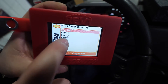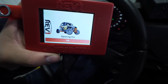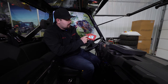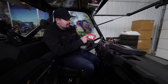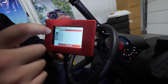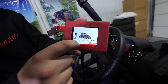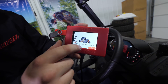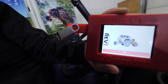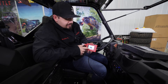We're going to click copy the tuner, go to an empty slot, copy to the slot, and let it load up. It's copied to the ECU — hit the back arrow again. Then we're going to go up here to the top left and click on tune ECU. We have our STK stock tune and our S1R stage one. We're going to tune the ECM — check that ignition is on and press OK. Our ignition is on, so we click OK and let it load up. The ECU tuner has tuned the machine — flashing is complete at 100 percent.